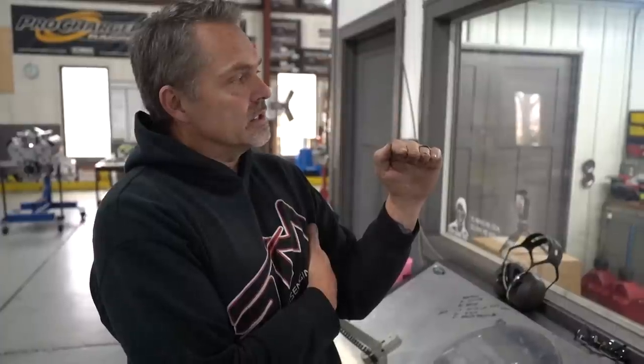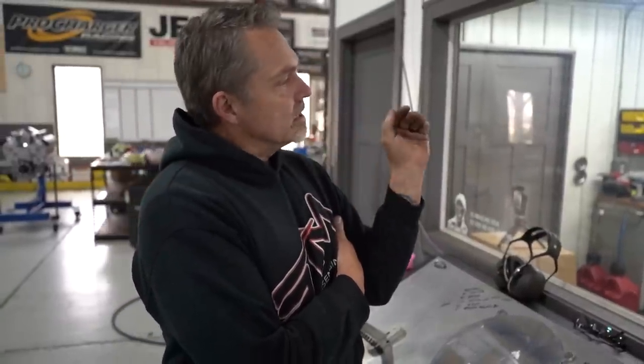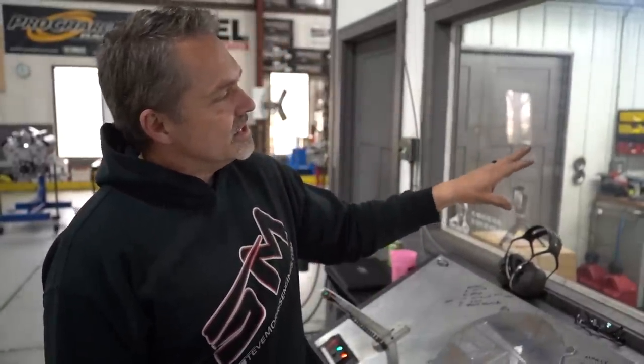Well, I think all things said and done, I'm happy with where it's at. The plugs look really good even at that. I think we just need to lower the boost a little bit. And the beauty of carburetors is we can lower the boost and it doesn't change the fuel curve, or very minimally if any, because what it does is it moves less air, so it takes less fuel. It's automatic. It's an amazing thing. So anyways, I think we're actually pretty well done with this thing.